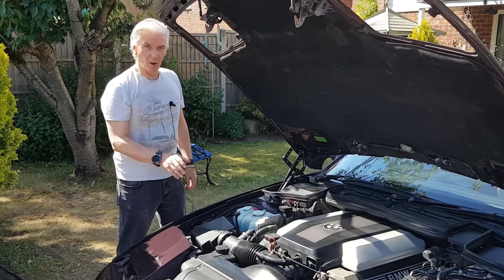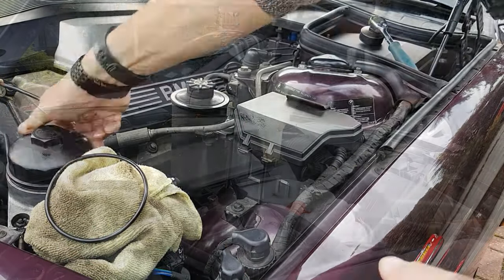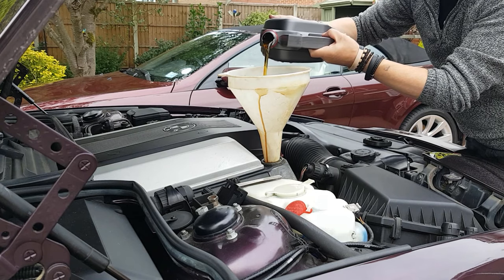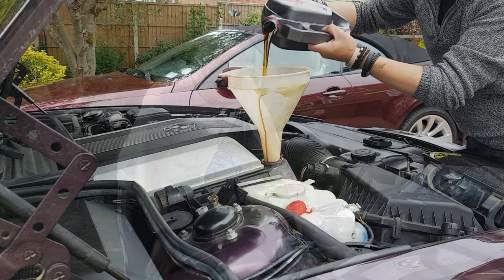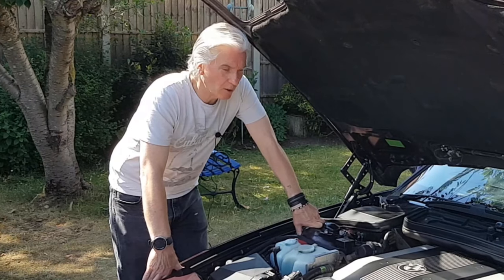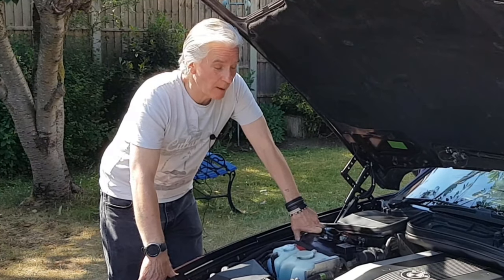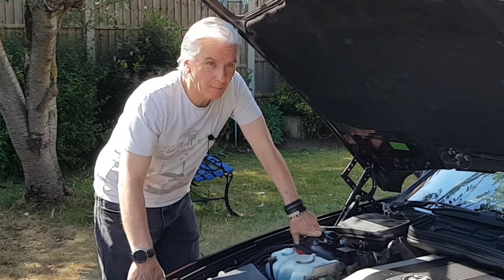Change the oil regularly and use a semi-synthetic or fully synthetic oil, ones with plastic softeners built into them, because modern oils have additives that actually help maintain plastics and rubbers as well as having their lubricating properties. It's the same with coolant as well; we've been through this before. A modern semi or fully synthetic oil is going to look after plastics a lot better. But much more important than that, if you change it every 10,000 miles or every year at the very most, then you're not going to build up any particulates. Of course, the filter's got to be changed at the same time.